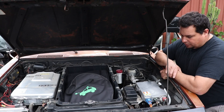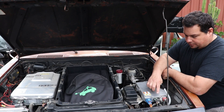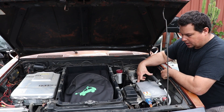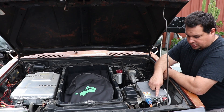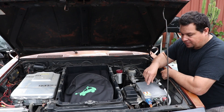Basically, this thing works by your 400 volts coming in over here, your communication port, your 12 volts going out to the battery, your water ports in and out. And this thing will operate as simply as just putting 12 volts to the enable wire on the communication port. It defaults to 13.5 volts.